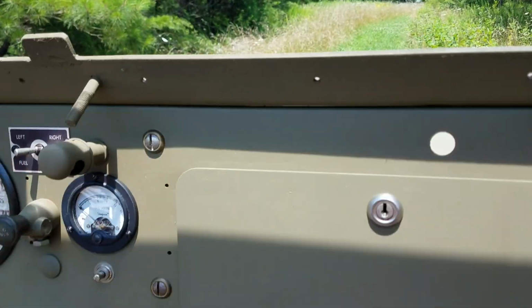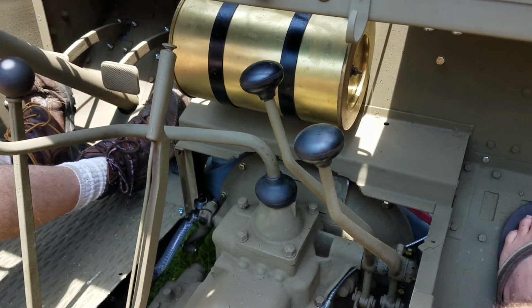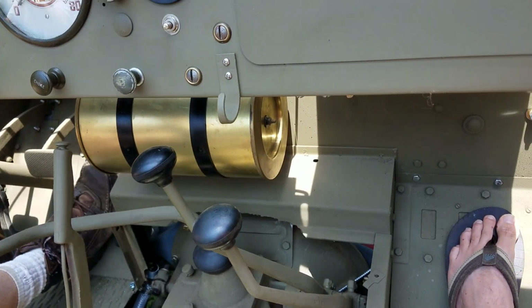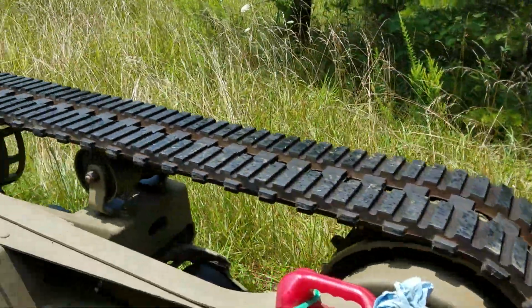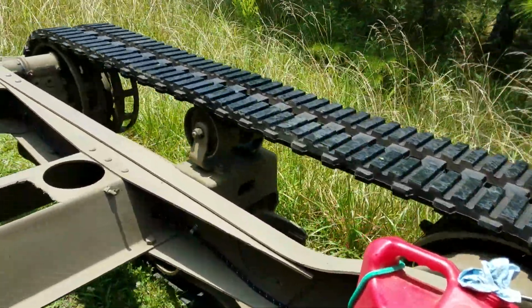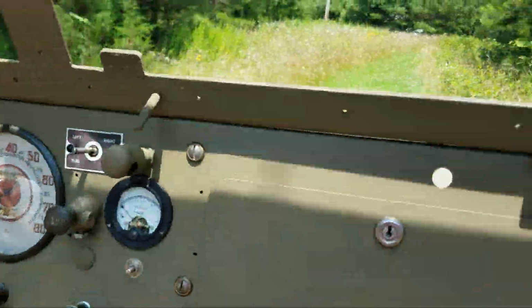If you hear a little noise every now and then that sounds like the fan hitting the shroud, that was actually the fan hitting the shroud. I had some old rear motor mounts that were letting the motor move around too much. I had to replace them with some heavier duty models, so the motor couldn't wiggle around.